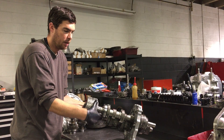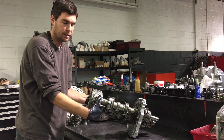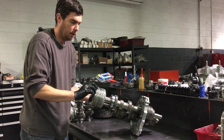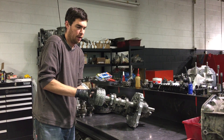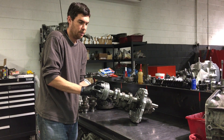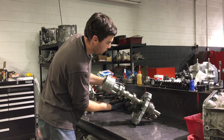So when we're in second gear and want to shift into third, the clutches will let go of second — the A basket — and then grab onto the B basket to engage third. We take off in third gear. As you can see, since it's still engaged in second, the A basket is still rotating at a greater speed until it pulls out of second.